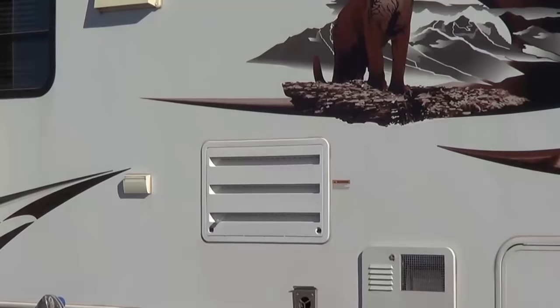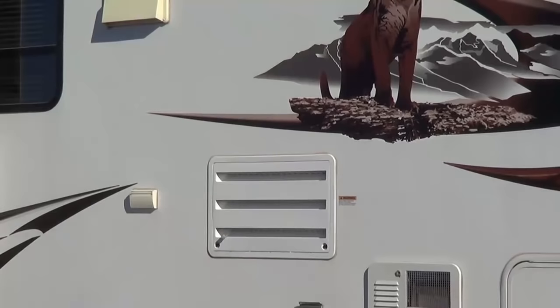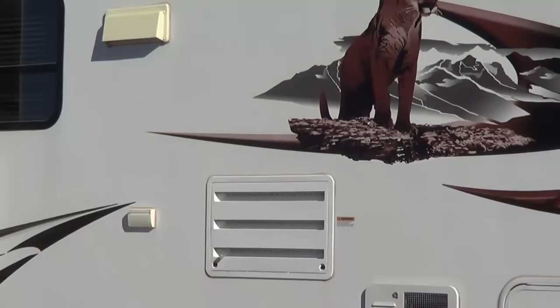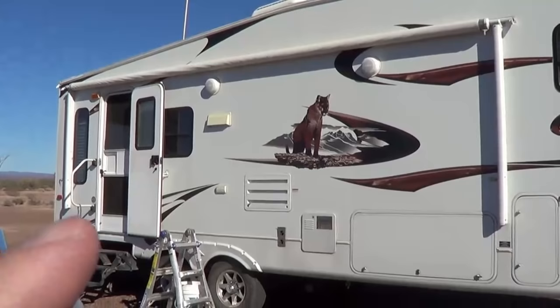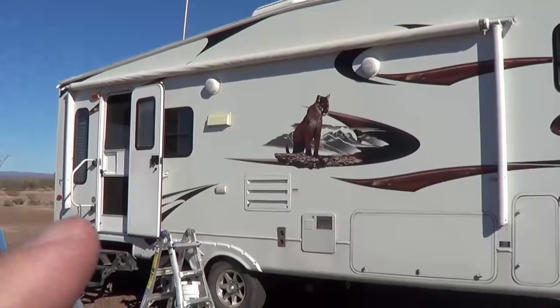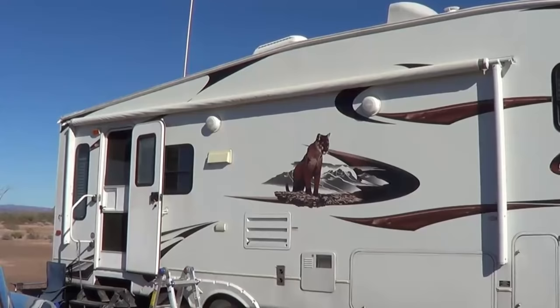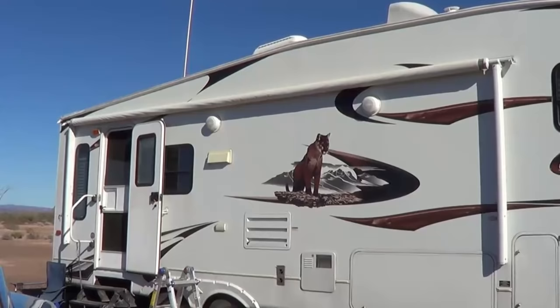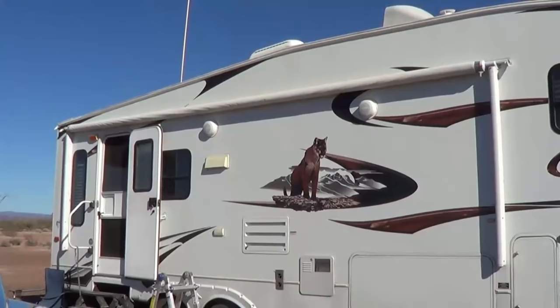Number eighteen is the fridge vent fan upgrade. The Cougar came with a noisy fan that would short-cycle annoyingly on hot days — I found the thermostat was located right above the fan, so the fan kept cooling its own thermostat. I pulled the fridge apart, replaced the original fan with a very quiet computer case fan, and moved the thermostat out of the way. Now I don't even hear the fan working, but I've tested it and confirmed it does run. I'll throw in a few stills so you can see what it looks like inside.